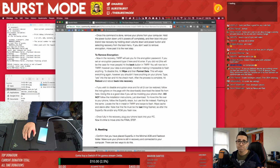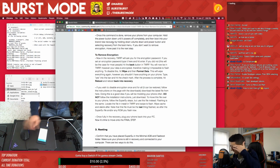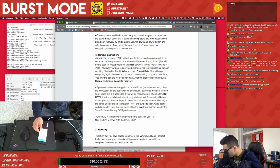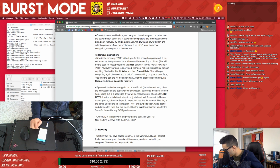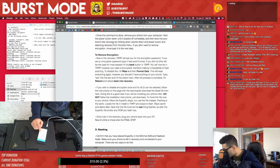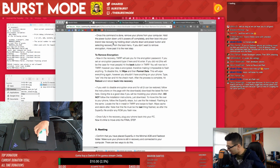It's okay. You're going to make a mistake. It's a learning process. Just be kind to yourself. It's no big deal. So let's pop into the settings here. Oh, we don't even have developer options. Apparently I haven't used this too much at all. We want to go to, what is it, the kernel? No, build. There we go. All right, so we got developer options going. They're on. Let's allow OEM unlocking. Excellent. Allow it. Enable the USB debugging. Cool, I think we're good now. So let's go ahead and turn this baby off.